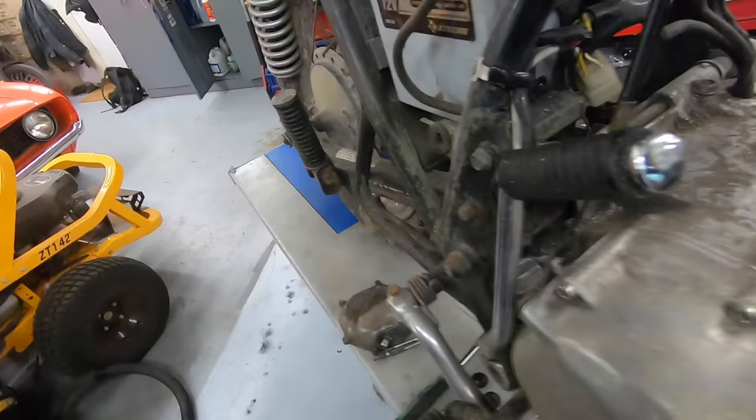I would love to see 30, maybe north of 30, with just the drill. That would be awesome. So let's see what it does. That was 45 PSI of oil pressure with just a drill. So, I mean, that's not a ton of RPMs. That is awesome. That seems to be working great. I did just see a little drop of oil come out of where our threads meet up. I just tightened that by hand, so that's not crazy surprising. But 45 pounds of oil pressure, that's sweet.